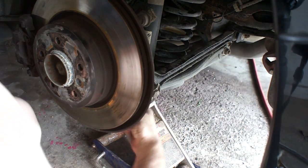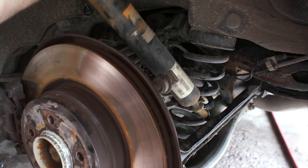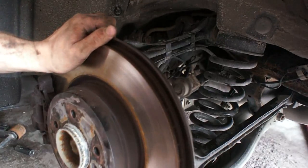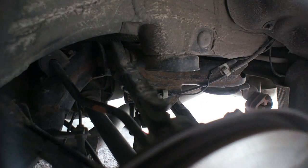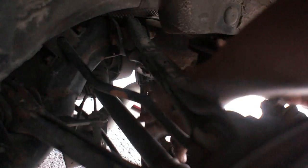Now we're going to the back — some shakier footage shot from inside the trunk. You're gonna have to put a nut on top of this bolt so the shaft won't spin, and then loosen the bottom of it. You'll have to take off all those interior fuzzy panels to even get to that point, which is a little bit of a pain. After the top nut is removed, there is one nut on the bottom and one nut that goes through the lower control arm that you'll have to remove. The rear is not a true coilover setup — it's actually an adjustable spring perch and a new shock. Getting all the old stuff out is pretty simple; the rubber can get a little stuck onto the bottom of the shock. The spring you can pry out if you put a little weight on there to push everything down with the control arm detached. The top spring perch — I scratched my head thinking it was part of the car, but you'll need to get that out, probably with a hammer.